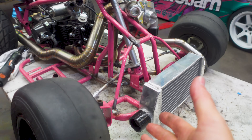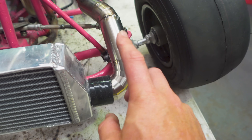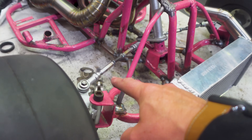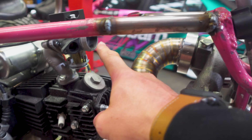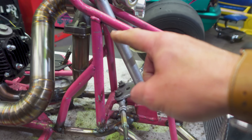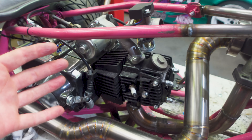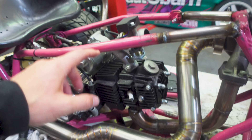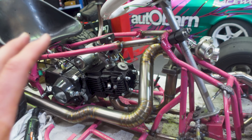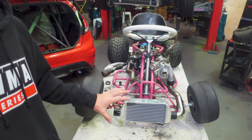I'm so freaking happy with that. It's turned out exactly as I intended, which is definitely quite surprising considering my lack of fab skills. Now we're moving straight on to the cold side, which is slightly more complicated just because there's more length on the pipe itself. What we're going to do is the same as what we've done on this side out of the intercooler. I think I want to tuck it up nice and close — basically out of the throttle body we'll go straight here and then tuck it in nice all the way down, making sure we're not getting in the way of anything. We have to think about future stuff — loom, wiring, spark plug lead, injector leads. Let's get the piping started and see where it's going to go.